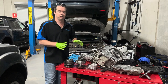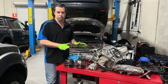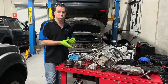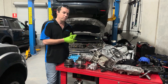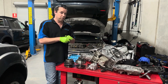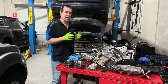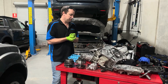They're also no good for towing — don't buy an Xtrail to tow. You'll kill the transmission; they hate pulling extra loads heavier than the vehicle, so don't buy a CVT for towing. Make sure you service it. If you've got a problem with your CVT, give us a call. Most times we can rebuild them, though there are a few vehicles where we put in new transmissions due to parts availability — we can't get parts for every CVT transmission and availability can be hard and expensive.